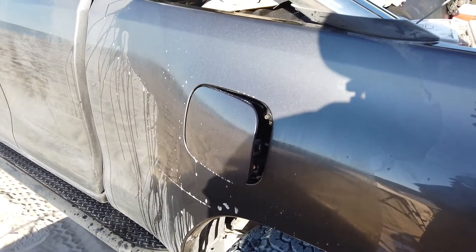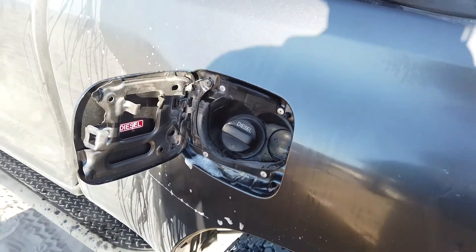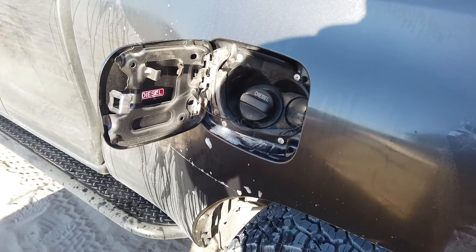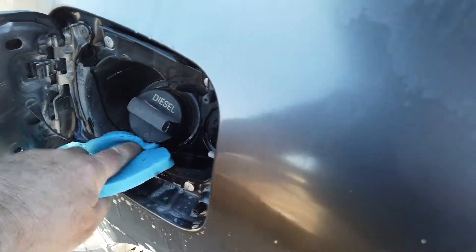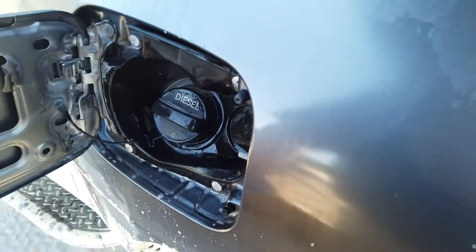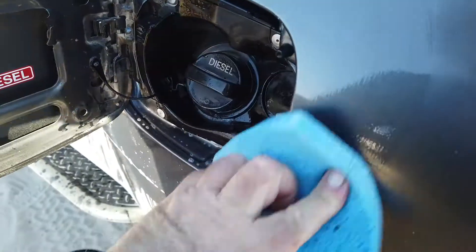Okay guys, I'm going to refuel from my jerry can. What I'm doing here is cleaning this area of all the dust. The last thing you want to do is introduce dust and grit into your refuelling. I'm getting in here with some soapy water, getting this area around the cap as clean as possible before I use the siphon line.